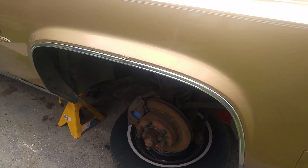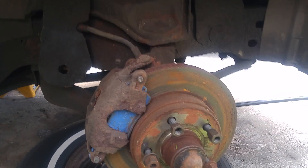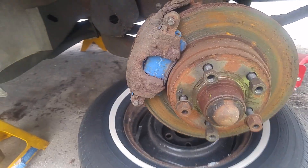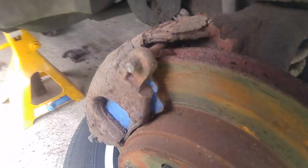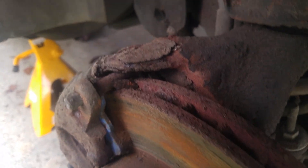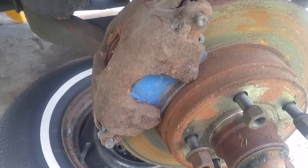I had to look at this '82. I want to know why she wasn't stopping. I've only pulled the one wheel so far but I have an idea what's going on. Look how rusted this assembly is. There's lots of meat on those pads front and back, but the caliper is just crusty and rusty, so I'm thinking the caliper is probably just seized up.